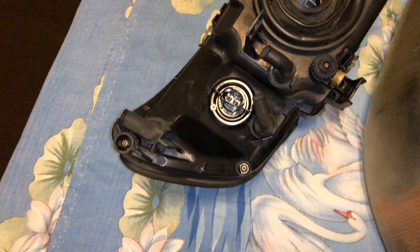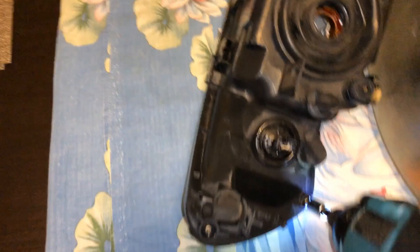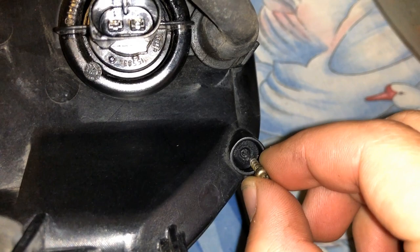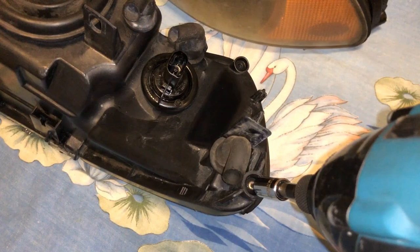Let me check the other light — same thing, 1/02. So much better than the other ones I had. Let me actually remove these little screws on the side and see if I can tell if the glue actually stretches or not. I'm going to try to record this myself. Voila — there you guys have it. So there's the definition of the little stretchiness. If your headlight has this type of material — glue, in this case — then you're looking good. I'm almost 100% certain that these are going to come apart and we're going to have a good time replacing these lenses without struggling.